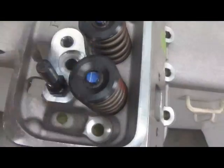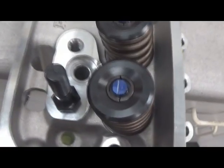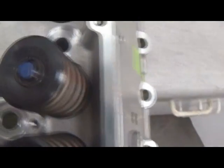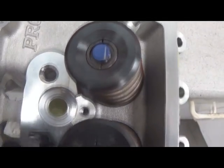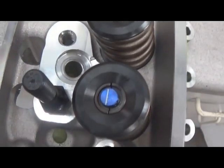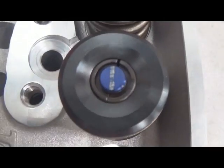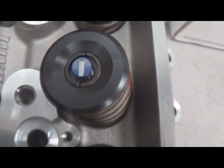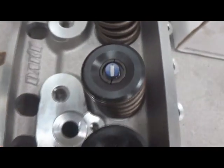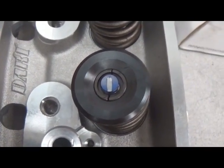I've made a couple of sweep patterns here. This one is a little bit towards the intake side of the cylinder head, showing you the push rod is too short. The next one, towards the exhaust side, is showing it's a little bit too long. Those are extreme examples, but towards the intake side means short, towards the exhaust side means too long. This one here is about center — that's what you're looking for, that's proper geometry and proper push rod length. A wider pattern can depend on how the cylinder head pads are machined and how the valves are laid out, but you still want it central on the valve tip to reduce valve train wear.